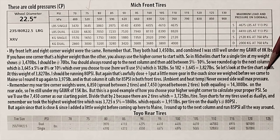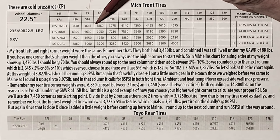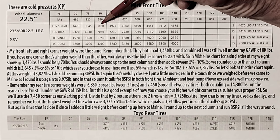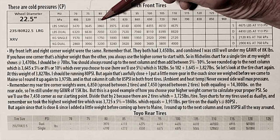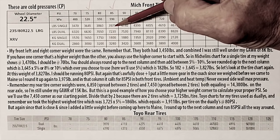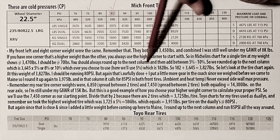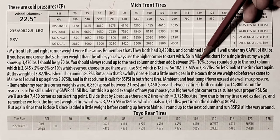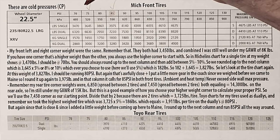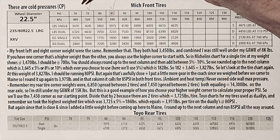Let's look at the tire chart again. Now we've got to round up to the next column again — we're just barely below that weight, and it's awfully close. Before Joni and I came up here to Maine, I did add a little bit more weight, so I'm going to automatically round up again to the next column, which is 3,975 pounds, and that calls for 85 pounds of pressure. Now let's talk about why we do this 5%, 7%, 8%, or 10%. You have to first have your baseline and when you're close, you automatically round up. We have to account for weight creep and ambient temperature differences. For every 10 degrees the ambient temperature drops, you're going to lose about 2 pounds of PSI.